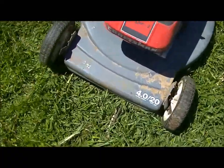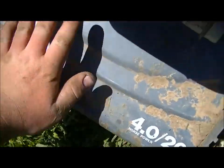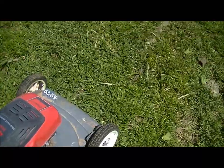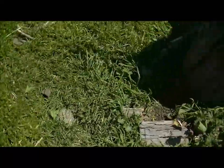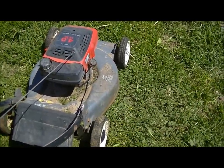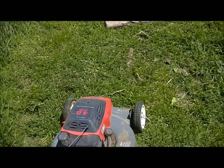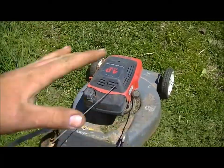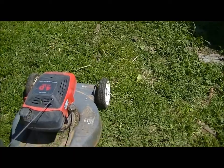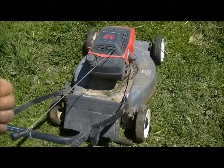I'm kinda tempted to just cut out the front — there's like a little circle doohickey — I'll cut that out and cut out the front, leave this top. Sorry about the wind. So it kind of catches the grass and doesn't just smoosh it down. It's cutting pretty good right now but it's kind of hard to push through. If the front was cut away — I'd probably use a grinder or a sawzall, not a torch — it would be a lot easier to push through the grass and cut it right at the bottom instead of cutting off the top and slowly going down. I'd cut it right at the bottom quickly and then mulch from the bottom up, which is easier on the engine than mulching from the top down. Anyway, my camera battery's toast. Thanks for watching.